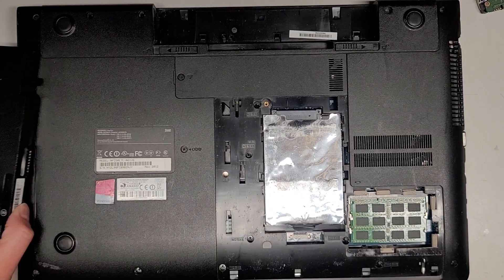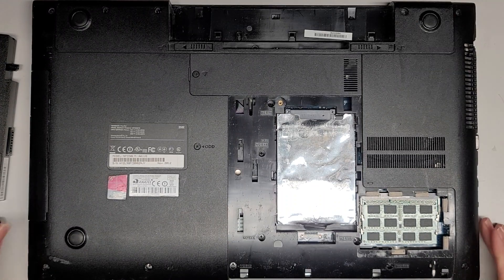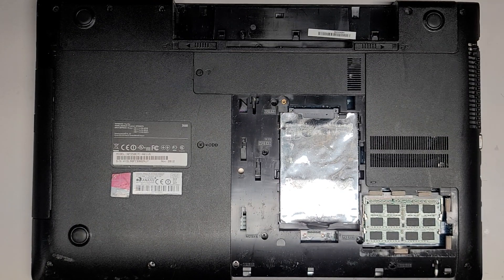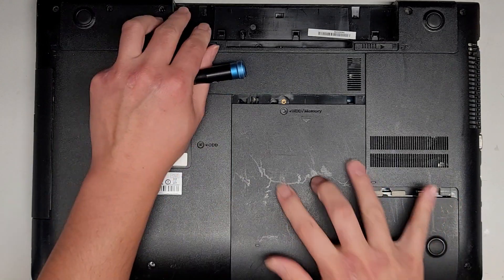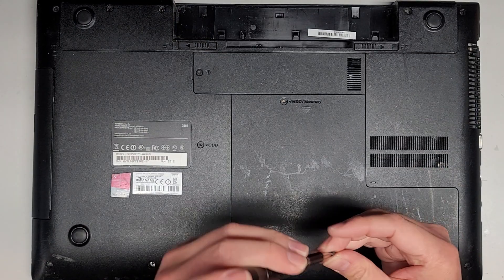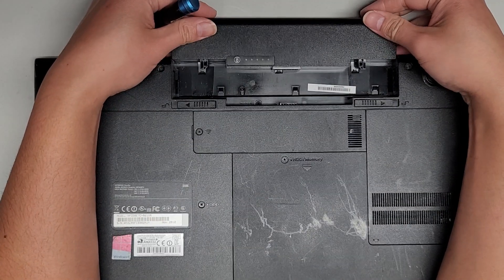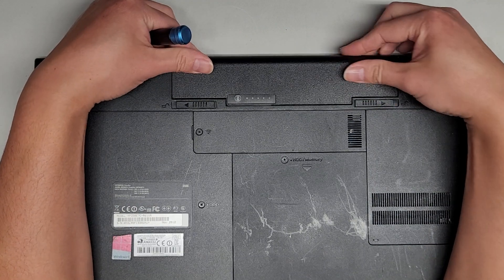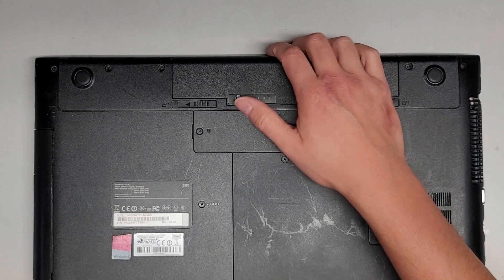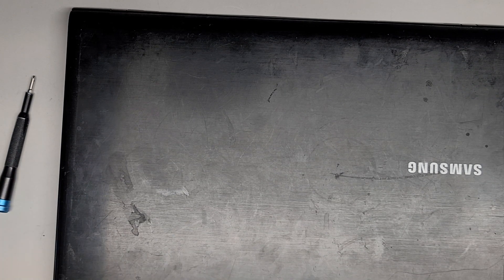Let's zoom out here — get the little piece back in, set this aside for now. Very simple. We'll get this bottom cover — start it down here, make sure it's flush, then slide it up. Once you've done that, we'll put this screw in. Then we'll get the battery back in — just line it up here and slot it in. After you're done, make sure these latches lock back towards the center. We're going to flip this over. Since it does have battery charge, we don't need to plug it in.